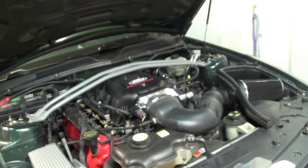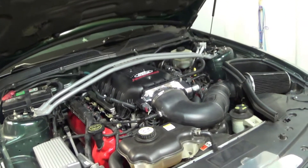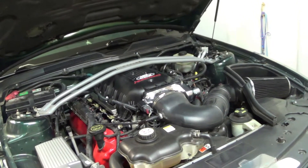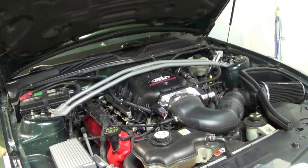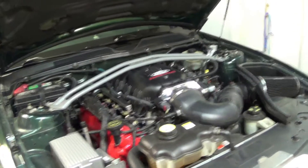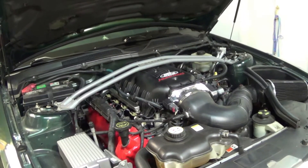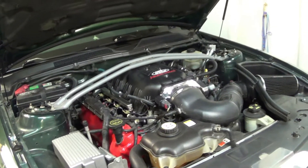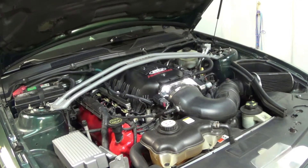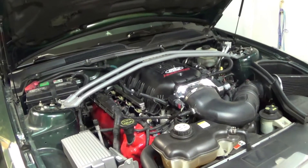I loaded the 87 octane tune. I also have an 89 octane tune and a 91 octane tune, because 91 is all we have here in New Mexico. For now I'm going to use the 87 and see how it runs. The tune went in fine - all together it took about 15 minutes. I don't know what other guys are doing that says it takes an hour, but it took about 15 minutes to download the stock tune and upload the custom tune. It seems like it's running fine, though it's just sitting here idling.